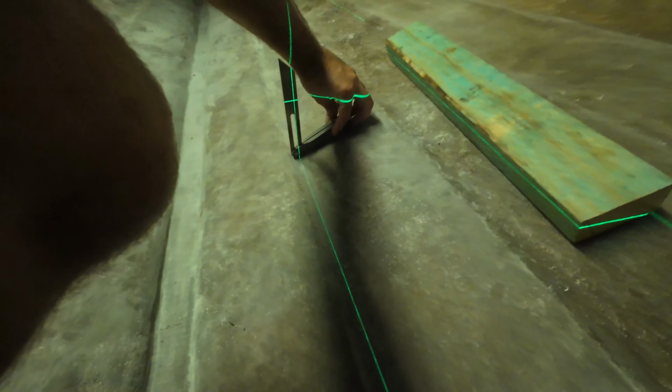And then you go another meter, and you can see we're starting to walk a little bit. Another meter, and you can see how far out we are. So every meter or for every 500, check it. But essentially I'm going to plane it or cut it down with the circ saw first at this angle, and then I'm going to plane the rest just using the hand planer.